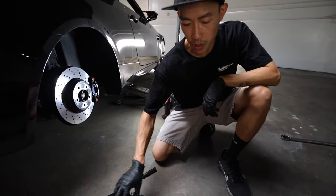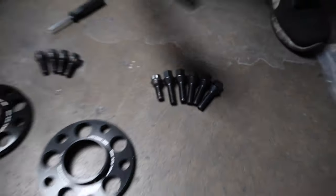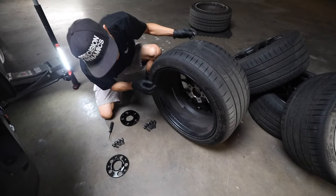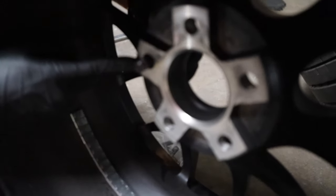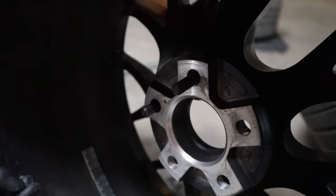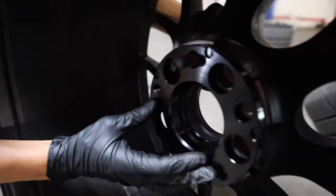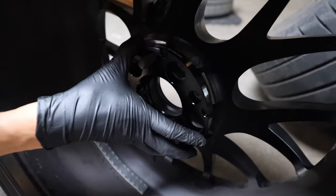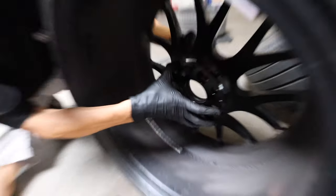Because we're running a 12-millimeter spacer, you can see the difference. I'll put the original bolt inside the slot so you can see how much is sticking out, then put the extended one in — way more threads. Now put the spacer on there, and you can clearly see the difference. That's why you never want to cheap out on spacers — look how many threads you're depending on versus the extended bolt.